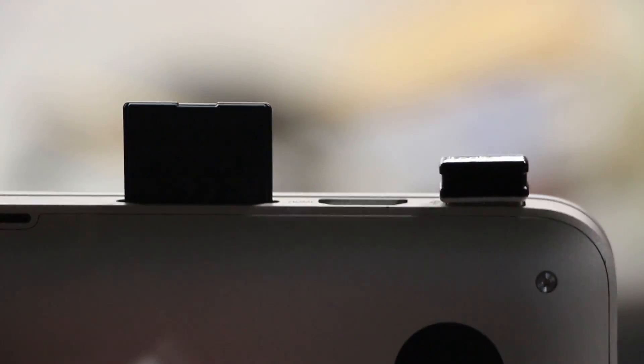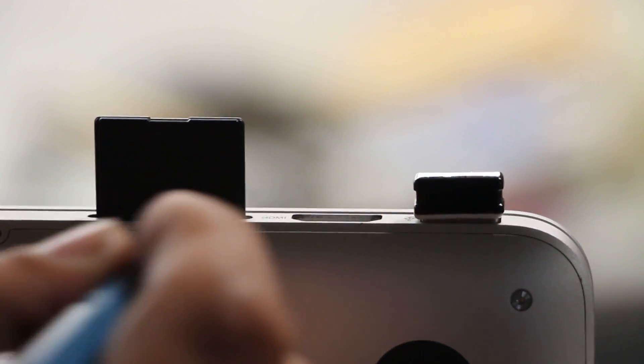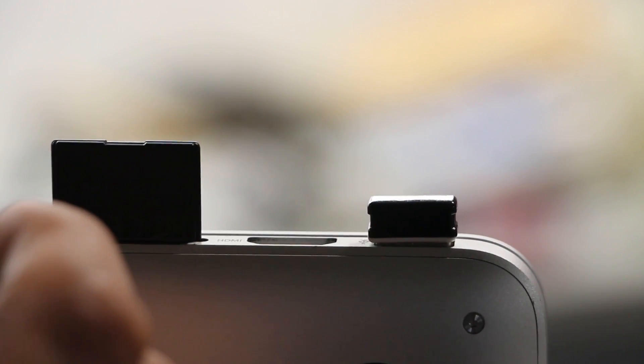When they made these originally it needed all this space, but now they don't need the space — though a lot of technologies like this camera still use SD cards. I'm going to go right along the bottom here and just score it, so I can see clearly where my line is, where the laptop meets. I don't know 100% how much empty space is in this SD card or how far it extends, so I'll show you a couple of ways to get around that. Hopefully the one you buy will have just the right amount of empty space to keep it flush. I've got it marked pretty well — marking the side so everything's very clear — and if it's been done correctly you should have a solid line all the way around.